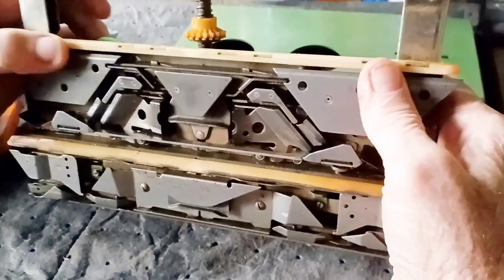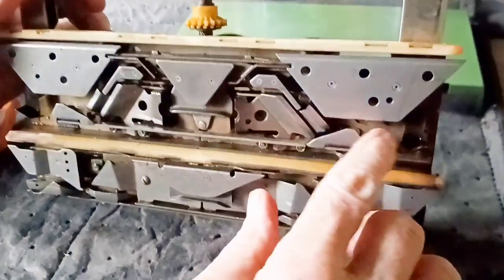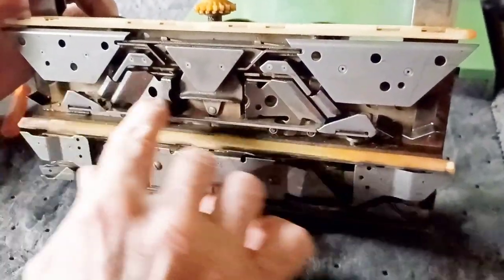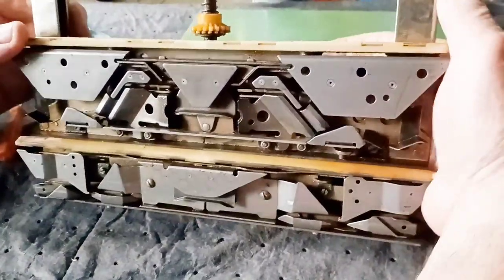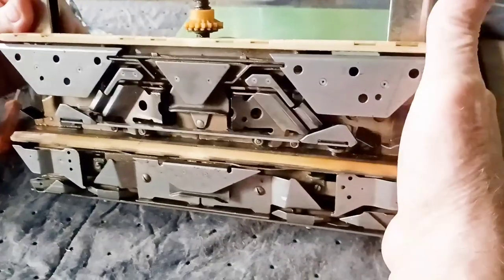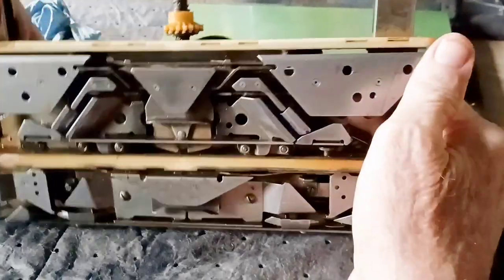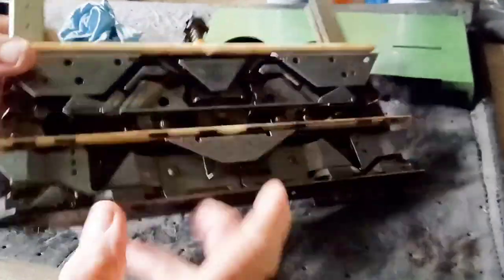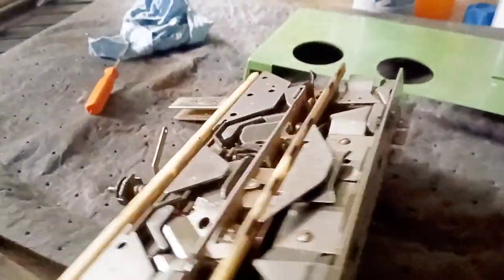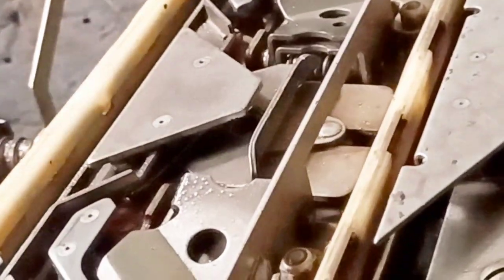Well, this is why GX gets you out of here. That's right. It's not engaging anymore. Everything is clear from the needle path all the way from side to side. And if it's working right, you can get out of the most ghastly spots and at least save maybe not your work, but all the needles in the machine and start again. And let's look. See, this goes down, this goes down, these two go down, and there you can get a good shot, if I can hold the light right, of these big heavy-duty coil springs I was talking about.